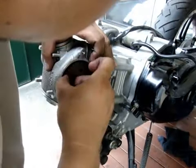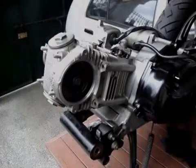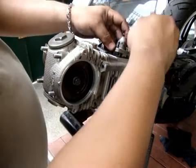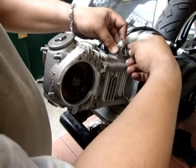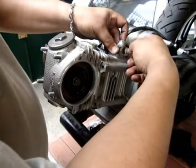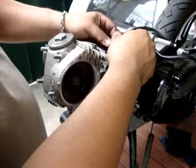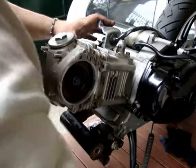And then you can put the wheel in like that. It's a little bit tight because the cam's new. Now to put the tensioner in, you turn it clockwise with the tensioner spring. It's loose, and then you can bolt it in. No need to adjust the tension, that's self-adjusting. After all that is in, you put the two anchor bolts together.